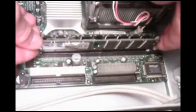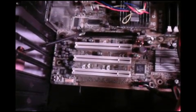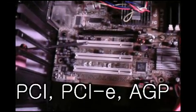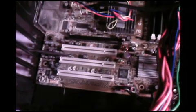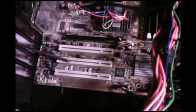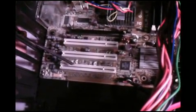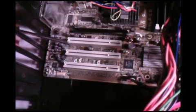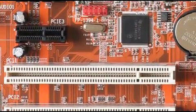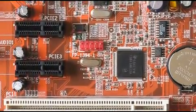To install a new video, audio, or Ethernet card into the computer, find the appropriate expansion slot that card will be installed into. There are three types of expansion slots these days: PCI, PCI Express, and AGP. You will typically find only a single PCI Express or AGP expansion slot, but you will often find many regular PCI slots. Video cards, especially the newer ones, tend to be designed for PCI Express slots, often called PCI-E. Sound cards tend to plug into both PCI-E and regular PCI slots, while most upgrade cards like Ethernet cards tend to plug into regular PCI slots.